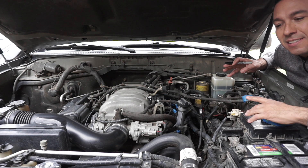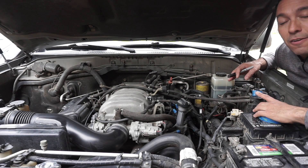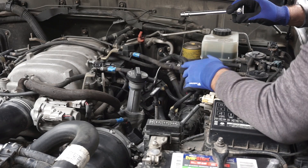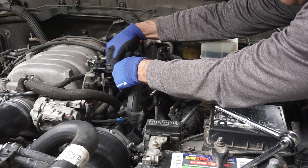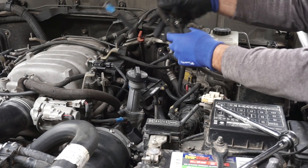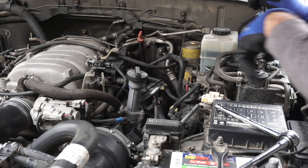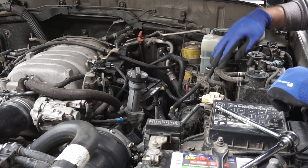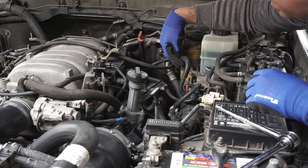Again, I'm not a mechanic — this is just for fun. I'm just a car enthusiast that does stuff at home. So first we're going to remove some hoses — these two top hoses. These are pretty simple; they're usually just a hose clamp, and you just pull them right out. Get these two hoses out of the way. It's also a good time to replace some of these hoses too if you have them.